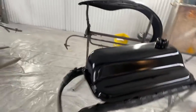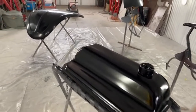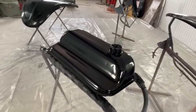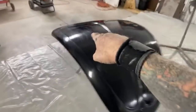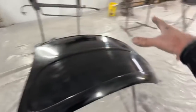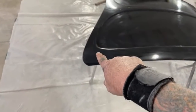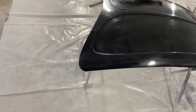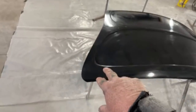If you're going to do a double coat, if you're going to do this double clear coat system, this is going to show you why you want to use the color blender, the DBC 500, instead of urethane clear. Now, I got to go back and blend some paint into that. If I was to put urethane clear on here that has an activator, a hardener, for me to blend some paint into that dry clear, I would have to put epoxy primer on it first. Because the reducer and the paint will react to the urethane clear coat.